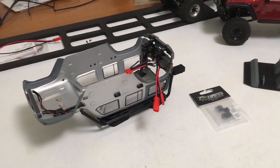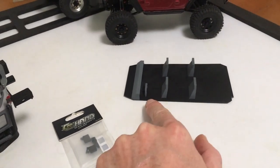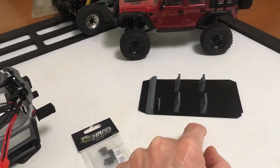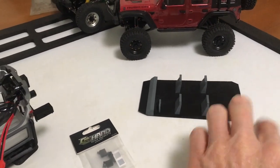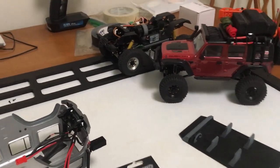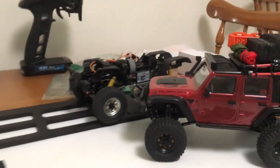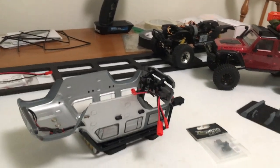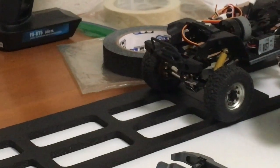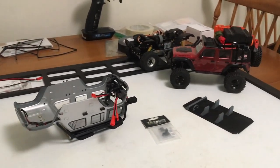So that's about ready to get back on, but before I do that, I want to get the CC hand mirrors on because those help hold it. The bolts on the inside sit right under this interior tray, so they help support that in the front. You can see I've got it cut out in the back for that light bar whip. And then I've got the other Jeep out here just to reference where I put the mirrors. Just a quick visual. But yeah, I'm getting there. Everything is wired up except for the bumper lights. So I've still got to pull the bumper, do a little work on it. So I'm going to get moving here, hopefully finish up this segment pretty quick.